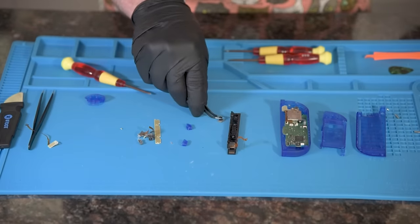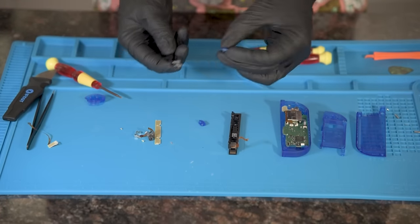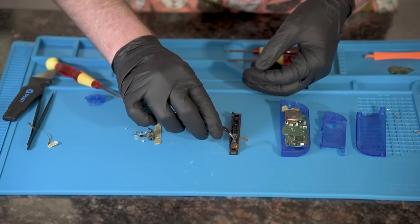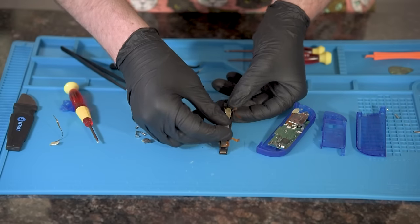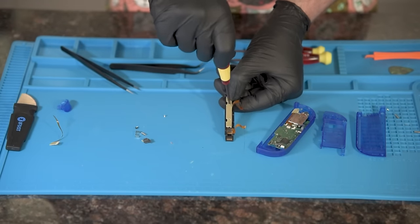I'm gonna start this time with a barrel button. Add the rubber and put it in the second from the bottom hole. Next, we will place the rubber in the remaining buttons and put them in the two open holes. Gently pick up your shiny button wafer, place the buttons shiny side down and cable on the top side. Use the two screws to secure the button wafer.